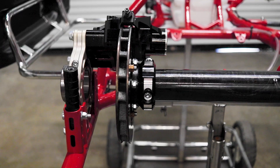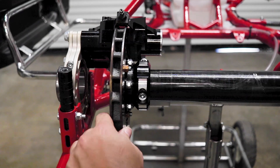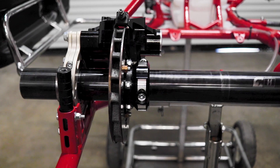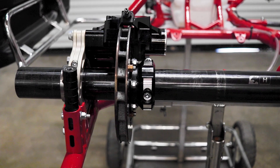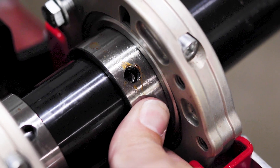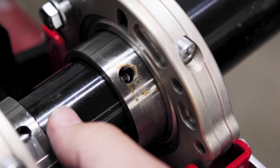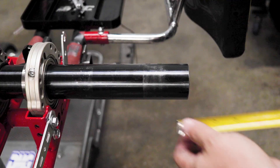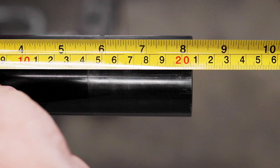Once you have your water pump belts on, slide the axle through the brake hub and into the last bearing. Make sure you put the key in the brake rotor. Once the axle is in there, go ahead and center it. A trick I use is to slide the bearing around the axle until you see where the set screws used to be and put them in the same spot — that way you're not marring up the axle in different locations. Just make sure both ends are the same distance and the axle is centered in the go-kart.